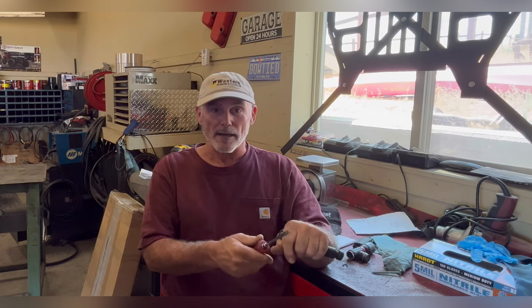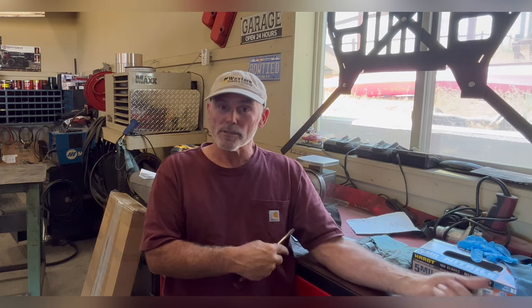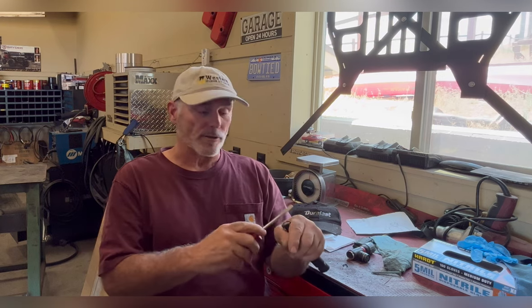You can pull that sensor out and wave across it and see if anything happens. In this case, I waved the screwdriver, the magnetic pulse triggered the fuel system and the ignition coils to fire. So it can kind of hone you in on what the problem might be. So that's what I'm doing when I say wave a screwdriver across the sensor.